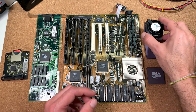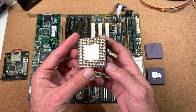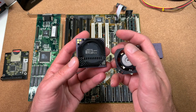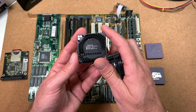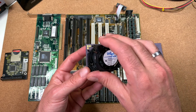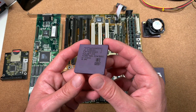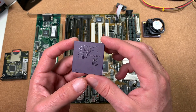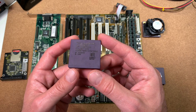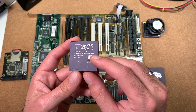So which CPUs are we going to torture today and compare? First, the Socket 3 Pentium Overdrive, normally clocked at 83MHz — a beautiful chip with integrated cooler and real Pentium power — we will overclock to 100MHz. Then the AMD X5 133, the latest true 486 CPU and of course the fastest 486, which is normally running at 133MHz and today overclocked to 160MHz.